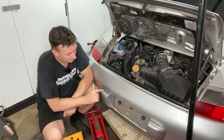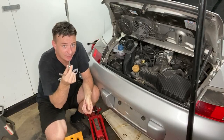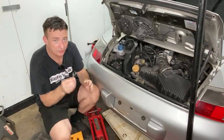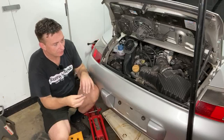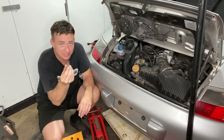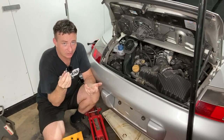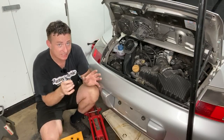To take off the little bumper extensions you're going to need an extension with a six millimeter allen wrench. On the bottom quarter on either side there are two each side, four total, T30 screws that you'll need to take off. Once we get the bumper off we're a step closer to being able to look inside the engine.